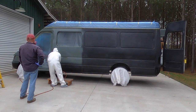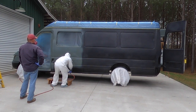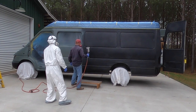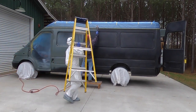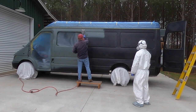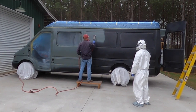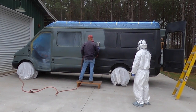As you can see here as we're spraying, we're trying to stop the strokes in a straight line and keep the gun aimed pretty much straight at the van. One strategy you can use is to try to always keep the gun nozzle slightly angled toward the direction you're painting — you don't want overspray on the area you've already painted because it will leave a textured, somewhat chalky finish. If you keep the gun angled slightly forward, your overspray goes in front of you and on your next section you'll cover it up.